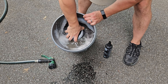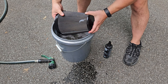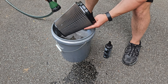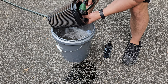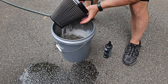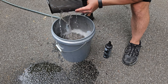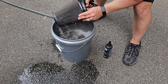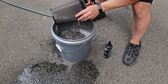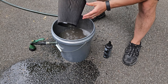Let's go ahead and put that in the bucket of water — you can see immediately the water turned brown. It's disgusting, but it's already starting to get this clean. I should have done this quite some time ago. If you want, with a gentle hose you can spray, but always spray from the inside out. Do not spray inward — that will embed the dirt. You can see how it's coming out from the outside; that way we are not further embedding any dirt. That's why the mileage interval doesn't matter — you have to judge the cleanliness of your filter based on how physically dirty it looks.